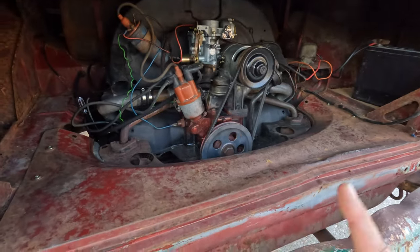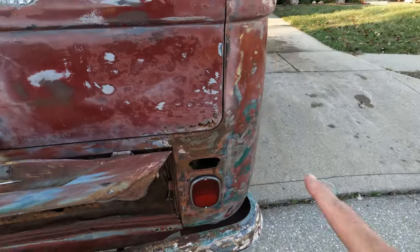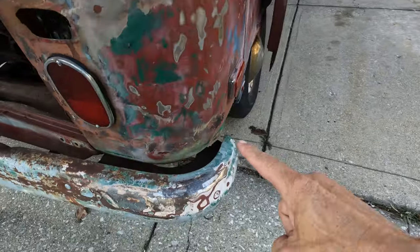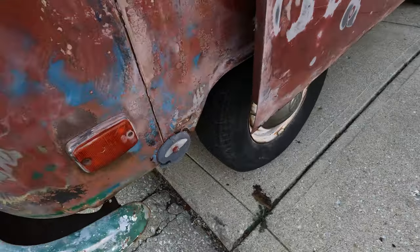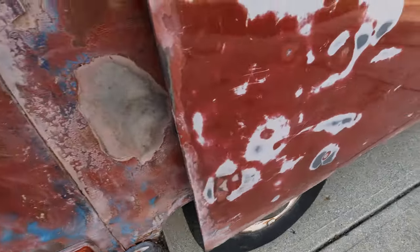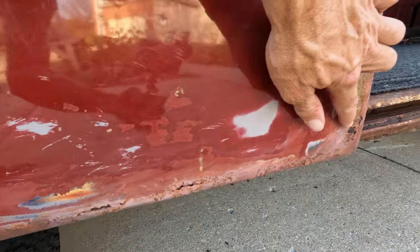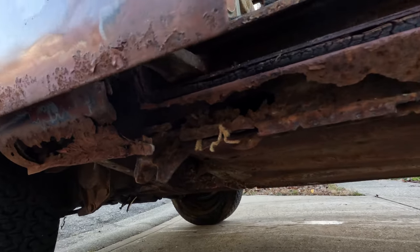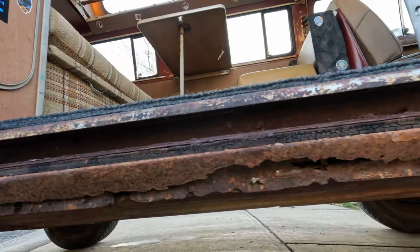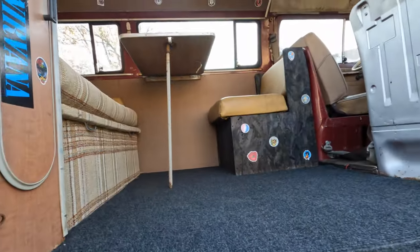It has a little dent here. I have that light. It has a little bit of body filler there. That's not so bad. The door is a little bit rough around the edges — there's a little hole there. Let's go under this panel, and yep, we have rocker rust. They sell that piece as well. We'll go under it in a moment.